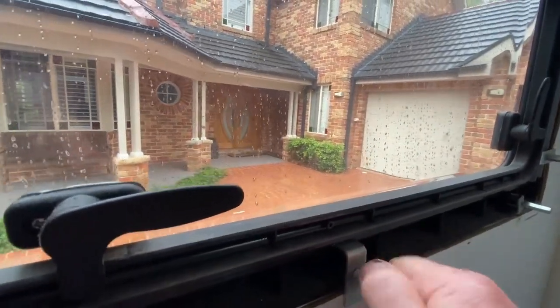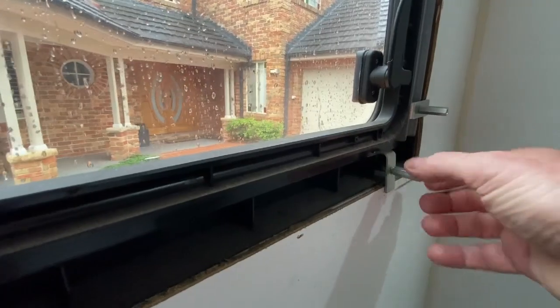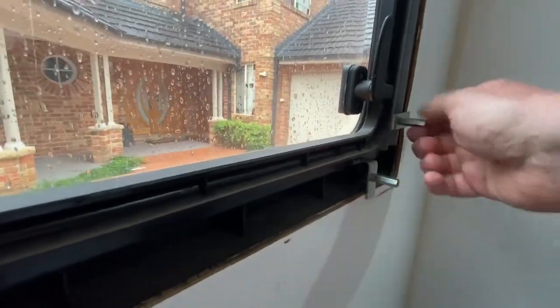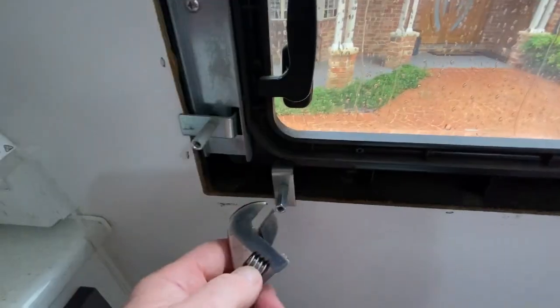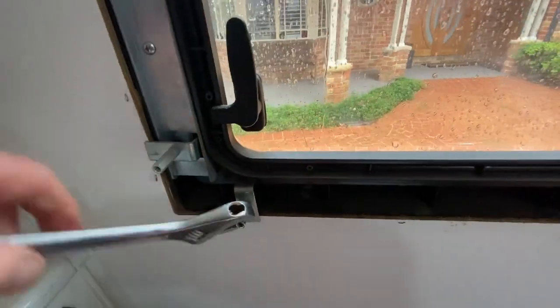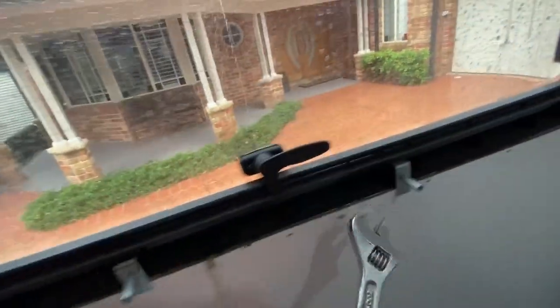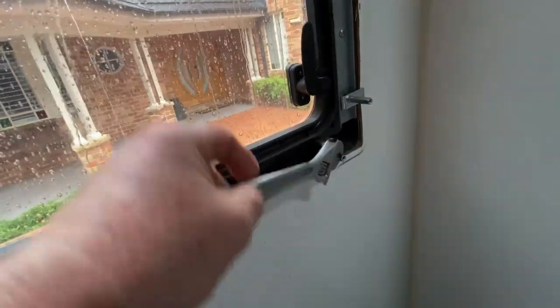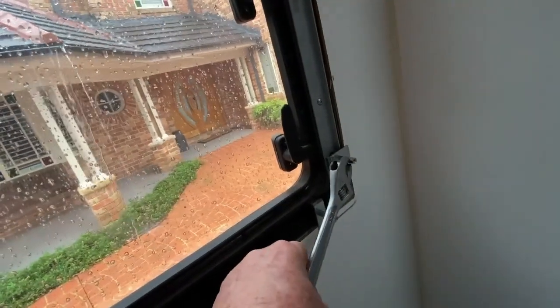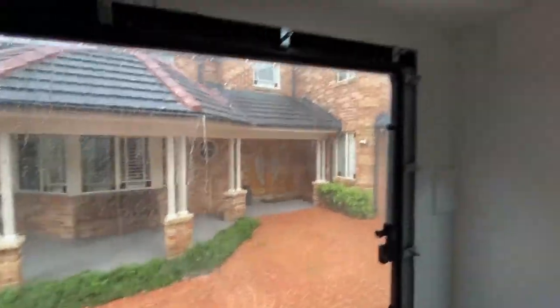It's worth, having said that, noting what we discovered driving around Australia because of these rough roads — it's really worth checking every single screw in every single spot around your caravan and make sure they're nice and tight before you fit it. Just get a shifter, make the shifter fit the screw and just give it a bit of a tighten, not too much — just enough to bring the tension back onto that screw. We don't want to crack the plastic. Check them all while we're here, and then we'll simply reinstall the outer screen and test it again.